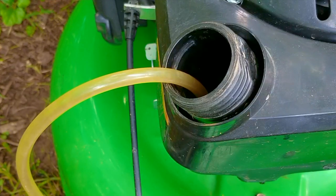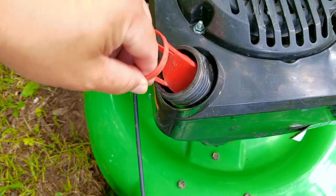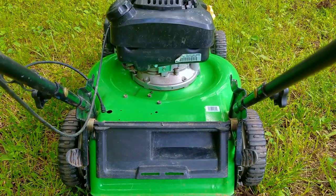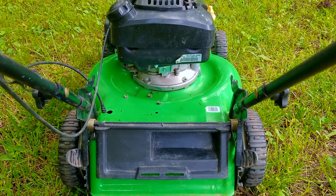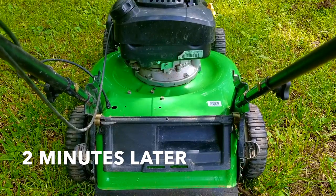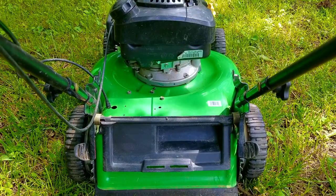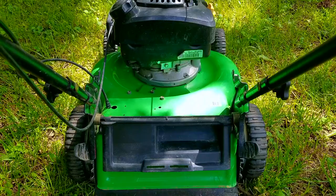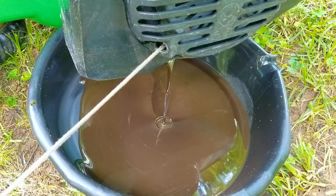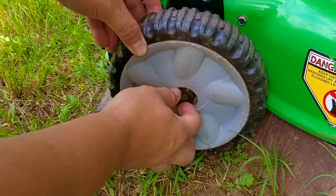That means we need to put this mower on its back so we can inspect it. To safely do that I'm going to drain all the fluids. After draining the gas I'm going to run the engine until it dies so there's no gas in the lines or carburetor. The good part about running the engine for a few minutes is that the oil is now warm and will drain from the engine a lot easier. The only reason I want the mower on its back is to make filming easier, but as you'll see later it doesn't go according to plan.